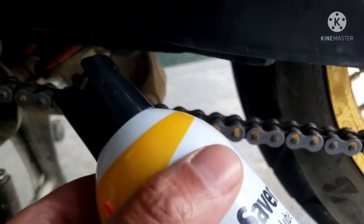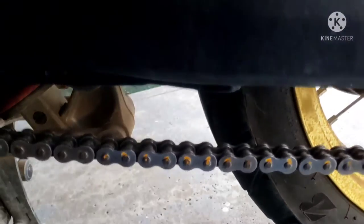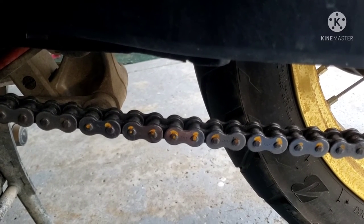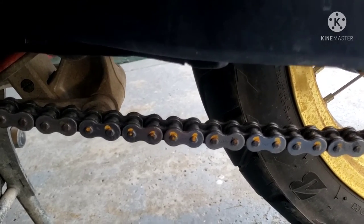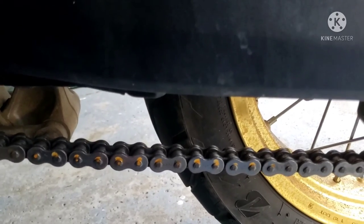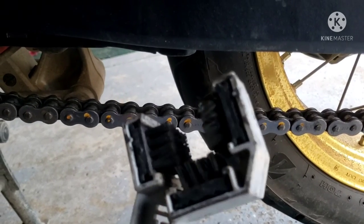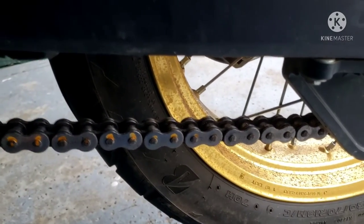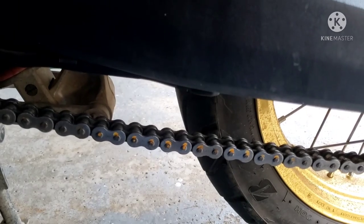Really, the only reason you put this lubricant on is to try to keep rust from happening, which works a little bit. A real harsh detergent like diesel fuel or kerosene is just going to eat that stuff away and leave you with a piece of junk chain. Simple brush with soapy water is more than enough to clean. That chain right there — I go off-roading all the time — look how clean it is. It takes no time. I hope it helps. If you have any questions, leave them down below. If you like what you hear, like and subscribe. Have a great day.